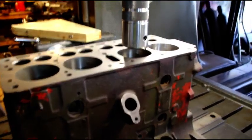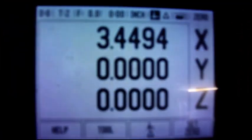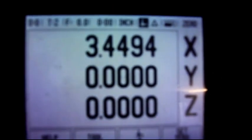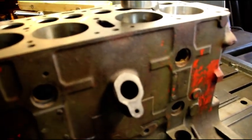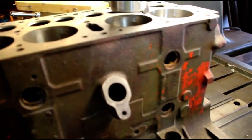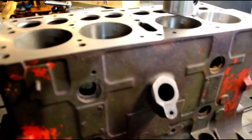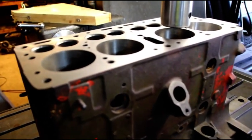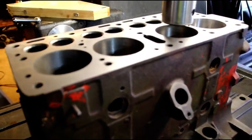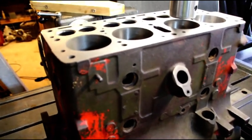That should read 3.4370. I'm twelve thousandths and four tenths off where I should be. I'm not feeling great about this block, but I'm going to try and see where I get. That's a little bit much for a connecting rod going up and down the cylinder to be off. So I'm going to bore it and continue on. I don't know how I'm going to like this one, but Travis, I'm doing the best to save this for you - but it may come down to the block not being saveable due to the wrong sleeve job that was put in there.